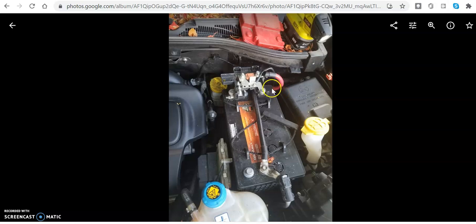I did have a previous battery that you had to keep watered, and that was a huge mistake. I wouldn't recommend having any kind of deep cycle battery that needs water in an automotive setting because of the corrosion and some of the challenges with that. I would really say don't go cheap on a battery. And again, this is lead acid. There's no lithium within the van, and this is just a cheap option that has worked great.